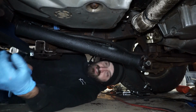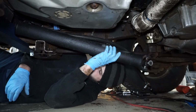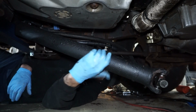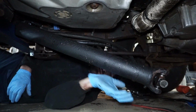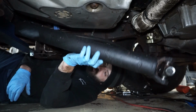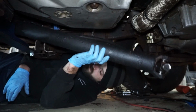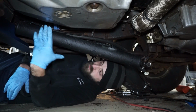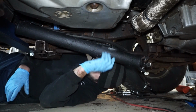And there's actually this cross member piece. The drive shaft hits this cross member first, so if the front U-joint were to break and this falls down, it hits that cross member, and even if it comes all the way over, it doesn't hit the ground unless the U-joint were to break, and then it would come back down. But the other concern I have is if it were to break, it's going to whip and hit the transmission. So I'm thinking maybe I could make a little bolt-in bracket as a stopper or something if it wanted to swing over, to try to protect the transmission.